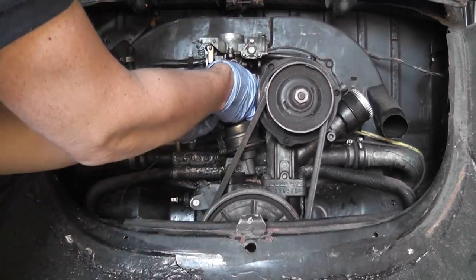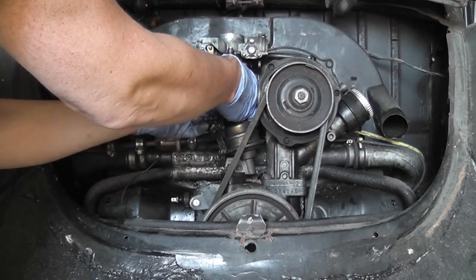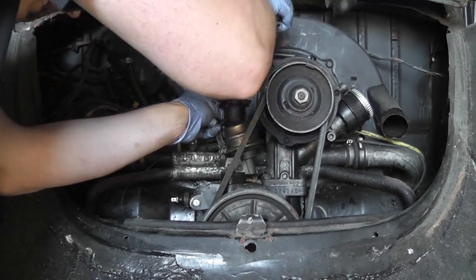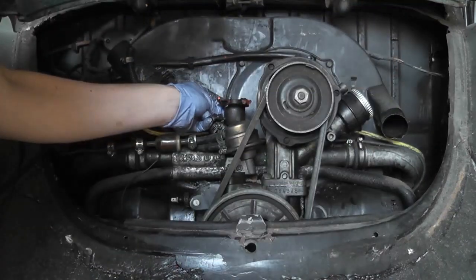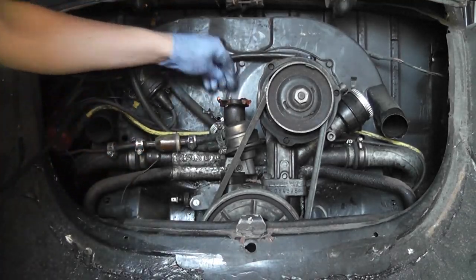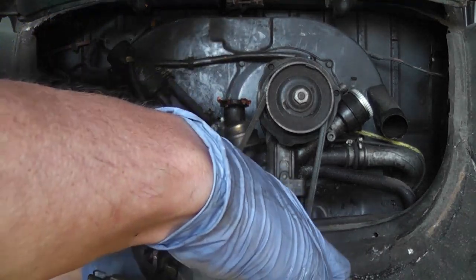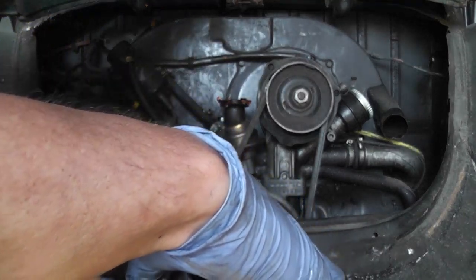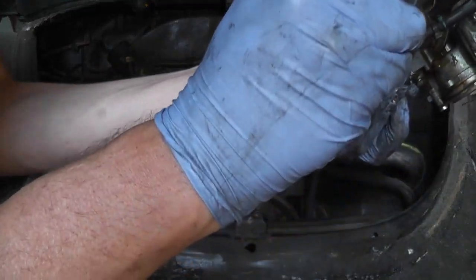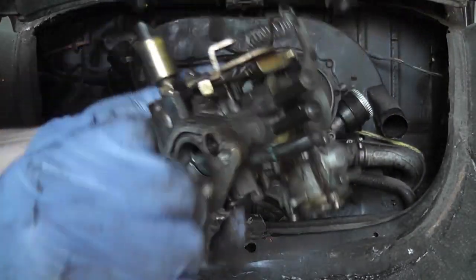The nut on the back is a bit fiddly. Big gob of bloody RTV sealant all the way around the base of the carb rather than using the proper gasket — for God's sake people. Bodge artists. And the threads are stripped out of the bottom of the carb. There's like an adapter on it as well. So we'll use some chemical metal to stick that stud in place and see how we get on. But that's straight away the wrong manifold for this engine.